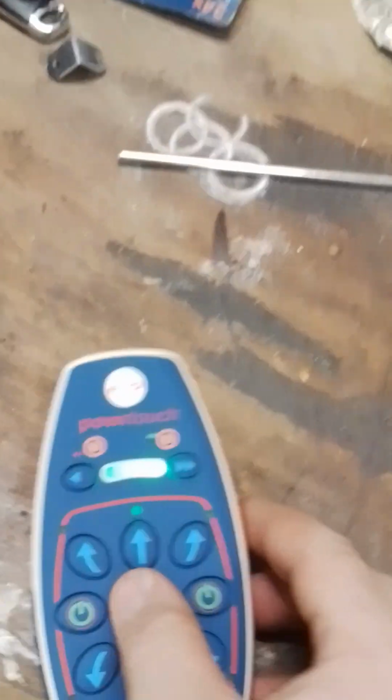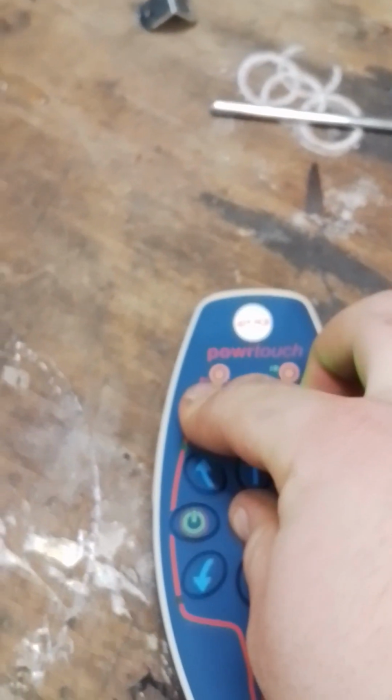Once finished, always apply the handbrake first, and then you hold in the centre button on the opposite side to disengage from the wheel. Once it's solid again, you can turn off the controller like so, and go back round to the battery box, turn isolation key off.